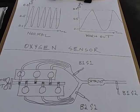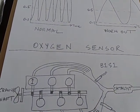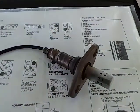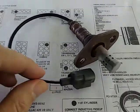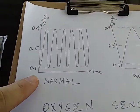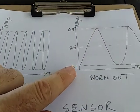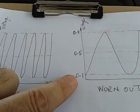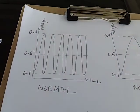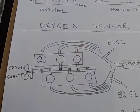Good morning! I was going to talk to you about testing an oxygen sensor since they go bad — it's regular maintenance. On my car I have one of these oxygen sensors, it's just one wire. A normal oxygen sensor switches pretty fast, and if it's worn out it switches very slow. By switching I mean it goes from 0.1 volt to 0.9 volt, so that's pretty low voltage — less than 1 volt.